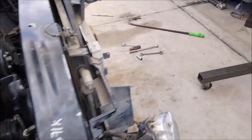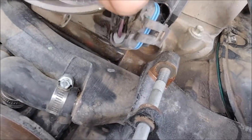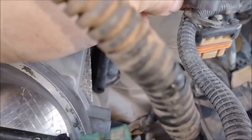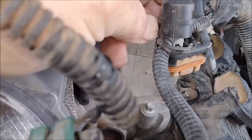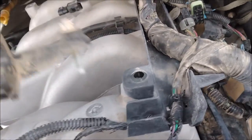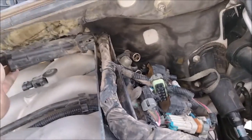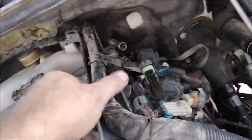I normally take the alternator off. On the 01/02 it has a TPS and a separate motor — there's a little slot tab here, you push it and slide it up. Then you've got your fuel lines and injector harness. There's a bolt here and a stud that holds the assembly on. On every 8.1 I've done, the stud stays in, so I just use a 10mm gear wrench and slowly unscrew it. That's also how you unplug the EGR plug.